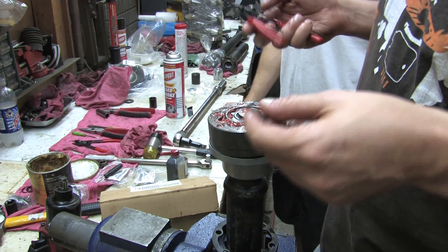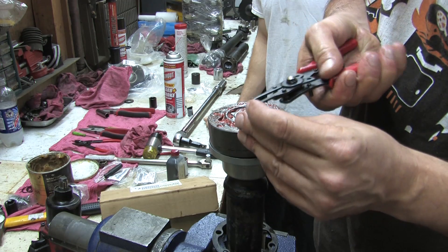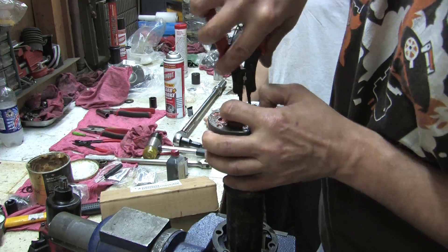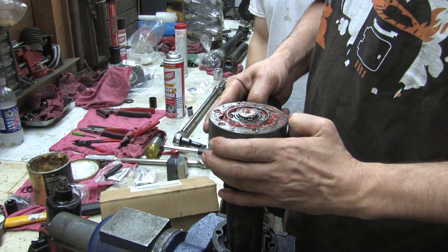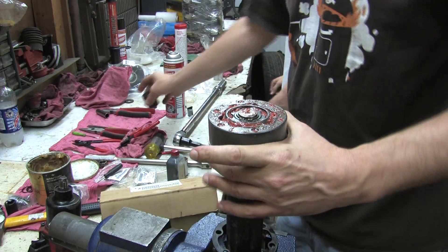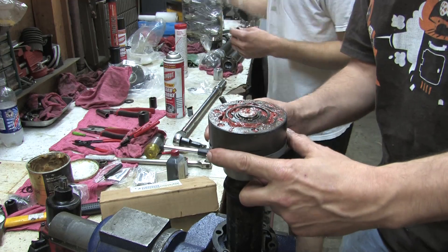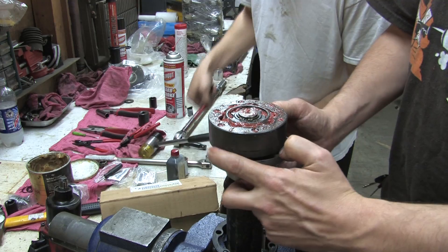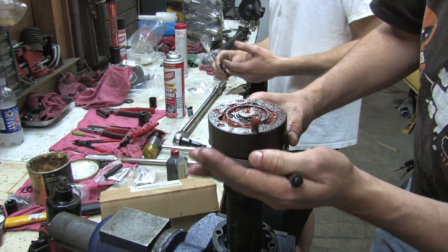The kit comes with a new snap ring. It uses a different set of snap ring pliers — these actually spread it out instead of compressing the ring in. You just place that over the groove. Another important thing before you get too crazy is to line up all the bolt holes around the outside of the Lobro joint with the boot. I'm going to take two bolts, then double-check the gasket — it looks like it slipped out of place, so definitely want to sort that out first and get it lined up.